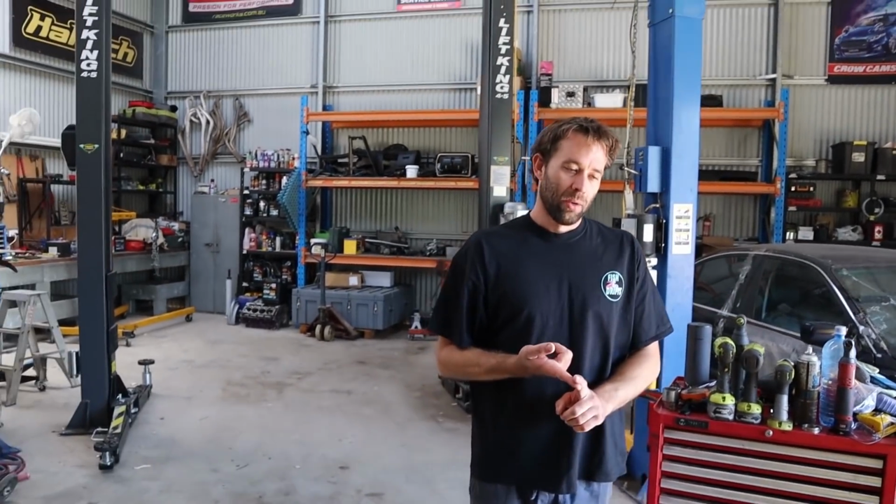So to test that, well really, I've already checked that. One of the two wires that goes to the alternator is just the charge light, which is an output. The other one has 12 volts from the battery, and then there's just the actual charge cable to the battery, which is obviously hooked up. Not really much that could be wrong.